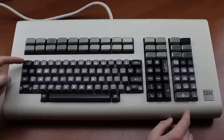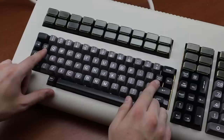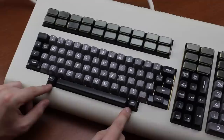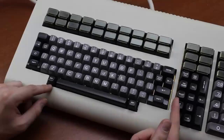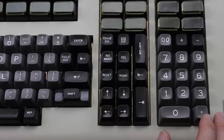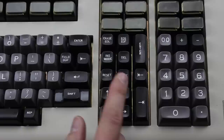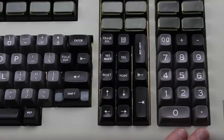The layout is fairly bizarre and will raise some eyebrows. There's this weird blank but not re-legendable keycap near the top left, and there's one extra column in the alphanumeric block to both the left and right, which makes reaching some keys like the right shift rather hard. It's got line and field duplicate keys, two front tabs and two back tabs, two rep keys — which I'm guessing engage the typematic, which is what repeats keys you keep pressed down — and two enter keys, as well as a separate carriage return key. Back then, return and enter didn't do the same thing like they almost always do nowadays: Enter was for executing commands, while return simply put your cursor on the next line. It's got a simple numpad with a double-zero key, a block nav to the left of it — this was several years before DEC and IBM would popularize the inverted-T nav we now use — and a delete but no backspace key; one of the enter keys occupies that space instead.